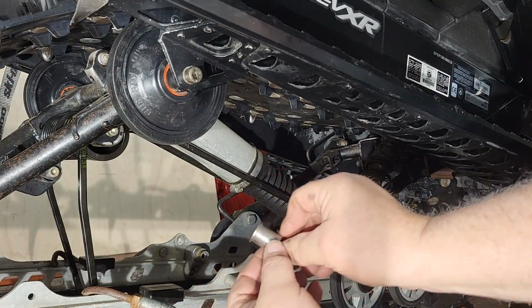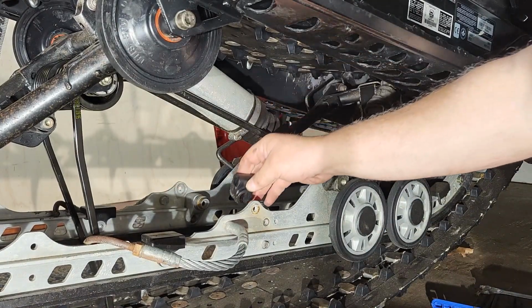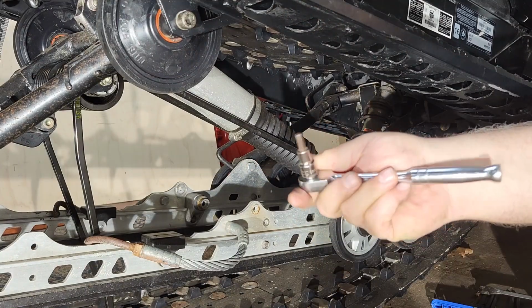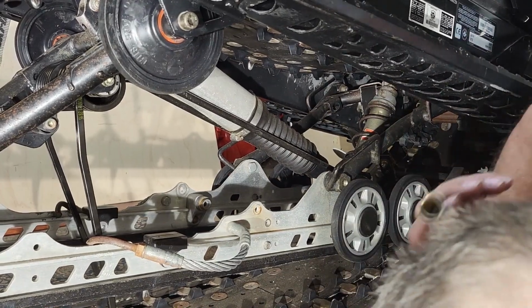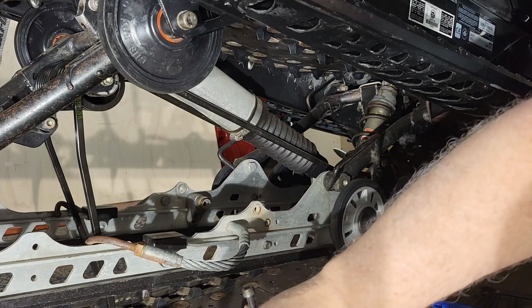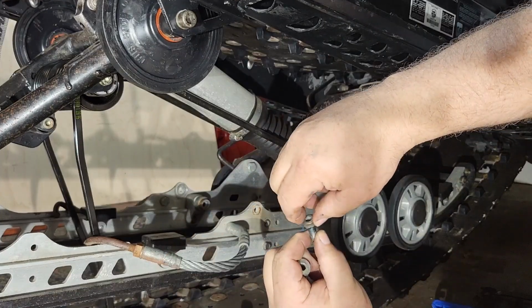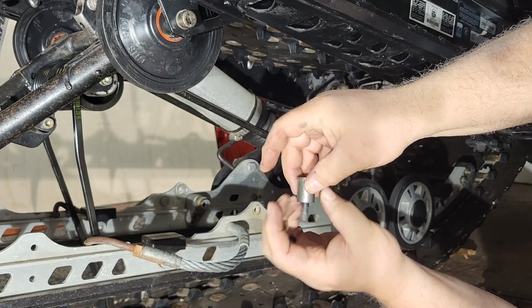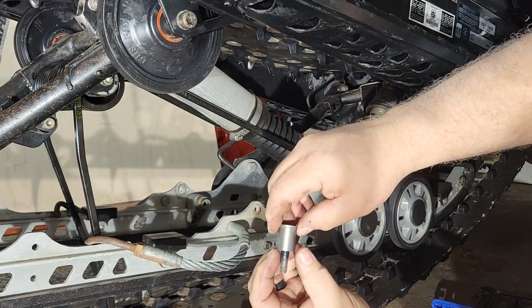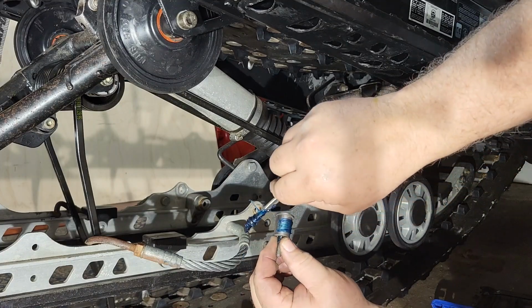This was all dirty. So you see I cleaned that all out. So this goes against inside of here. What do I got here? 6mm Allen wrench tip. This separates. So we're just going to do a little grease here, top part of the bolt. That's it. Drop it in. Mush it around. And do some grease. Even though it's in plastic, still the grease helps protect the metal.